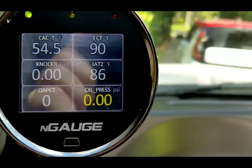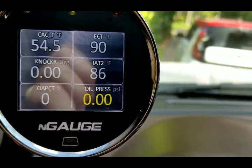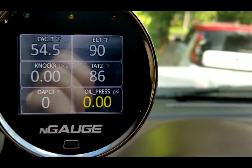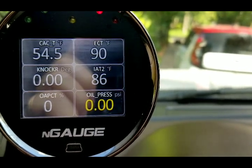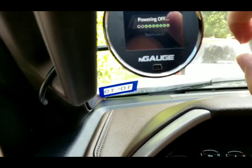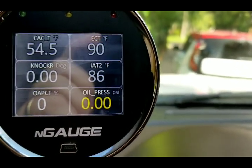Now, what I'm going to do is put my foot on the brake just like you have to to start any truck, but I'm going to floorboard the throttle — that will tell the engine not to start. Mine's a push button start truck, and I believe the computer will only let it crank for about five seconds. So I'm actually going to let it crank and not let it start so you can see that oil pressure climb.